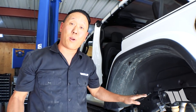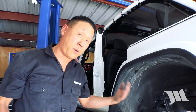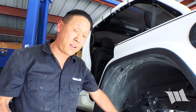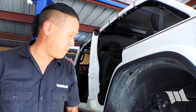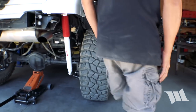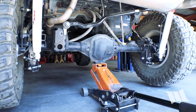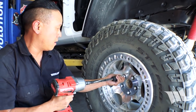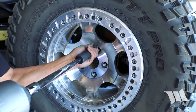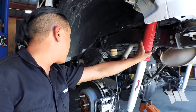Literally — in the past, the emergency brake cables routed up and over a cross member would have made it a lot more difficult to remove the coils. But because we relocated them on a previous lift, the axle just drops all the way down and they're already out. We get the other coil out, get the tires off the ground a bit, and remove the tires. Now we can go ahead and remove the shocks completely from the frame using an 18mm socket and wrench to loosen them up.